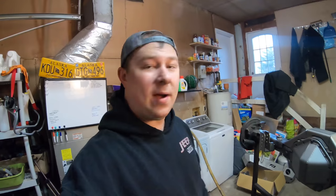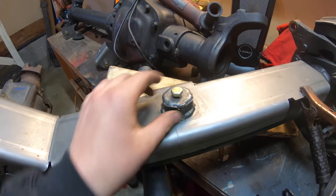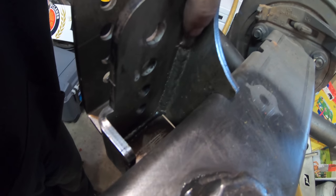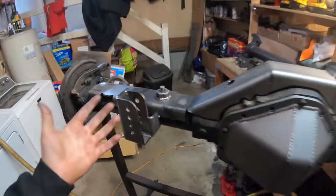Track bar is going to sit right in there and that all looks good. We're going to go ahead and weld this up along the inside and all along the outside. It is almost time for me to take a break — I've been out here for a couple hours welding. We've done the coil buckets, tacked the truss on, and tack-welded our rear track bar bracket to the truss itself. I don't want to weld anything to the tubes until the very end, once everything is in pretty much perfect alignment. The Barnes kit makes everything really easy to line up — there's a little slot you just pop it in, make sure it's straight, and tack it in place.